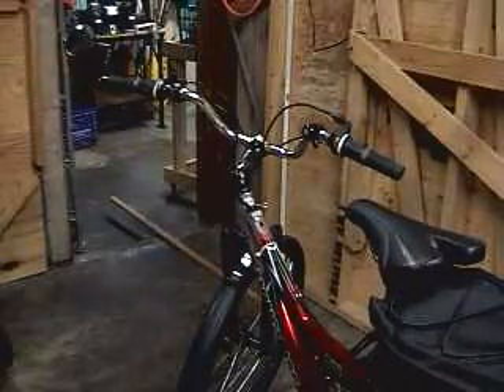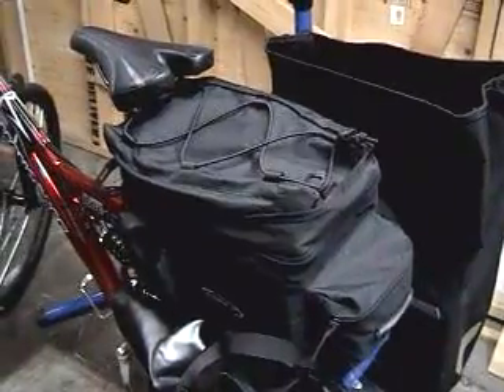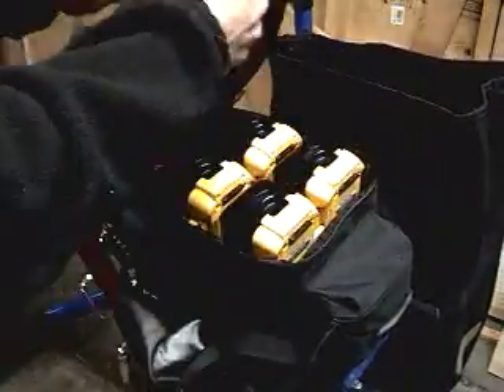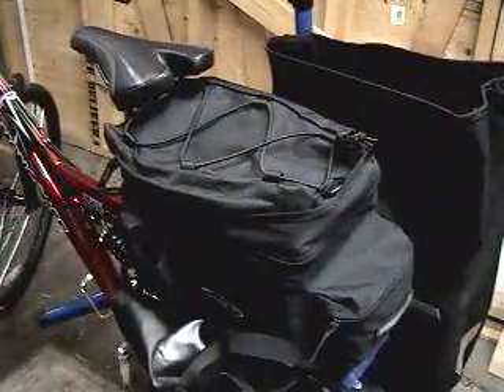Plug-in hybrid vehicles have been waiting for viable battery technology. That technology — nano-phosphate lithium-ion — arrived one year ago in the DeWalt 36-volt power tool line. I can carry two, four, or six depending on trip length. These batteries can dump 30 amps continuously, are good for thousands of charge cycles, and take only 30 to 60 minutes to recharge. I wired two packs in series for 72 volts.